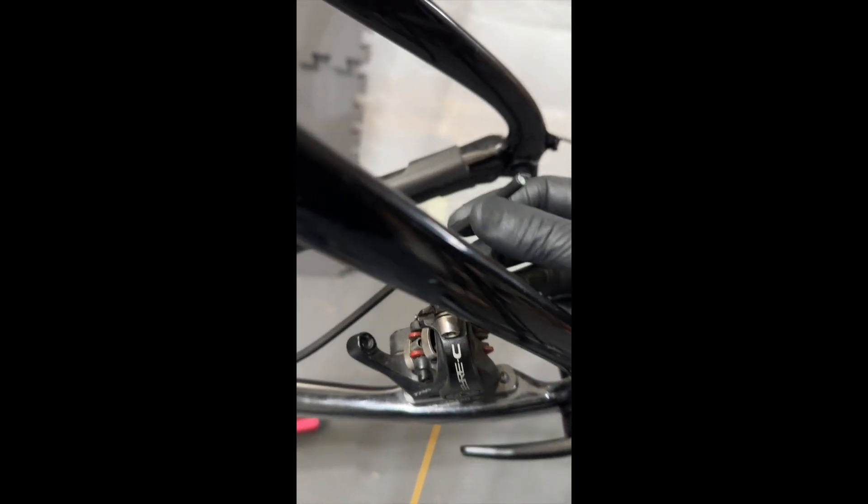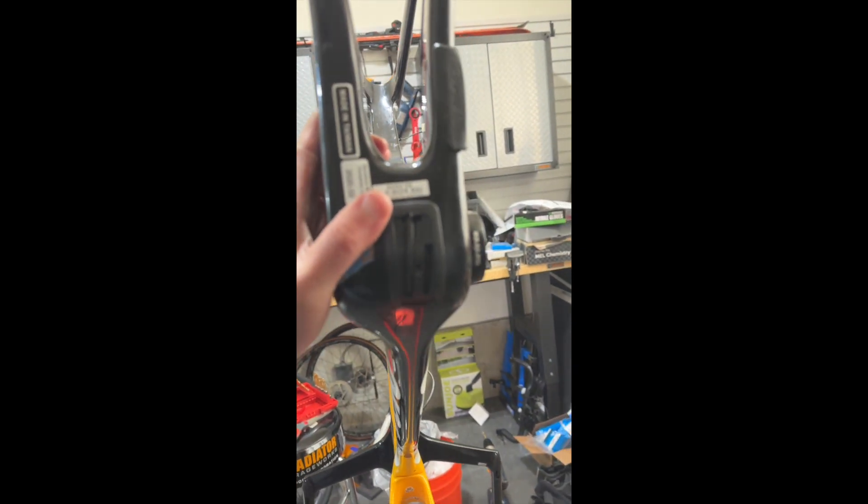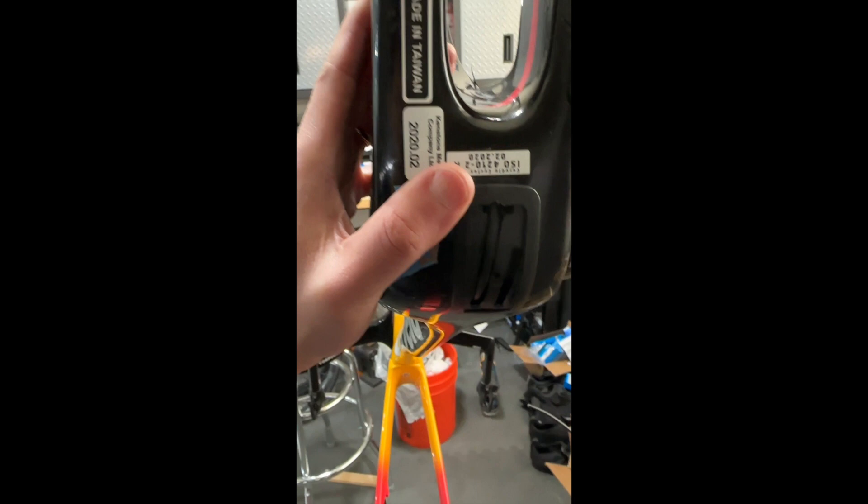After going through some painful exercise, I have the rear brake cable rerun and working again. I've made the bracket a lot wider and now I have the hydraulic brake cable going through here. It was a pain to put this all back in, but the bracket is now held in place — the only thing holding it in place is the friction of the hydraulic brake cable.